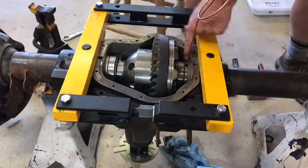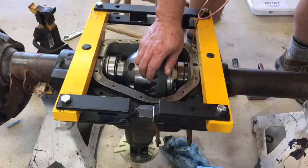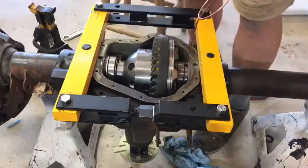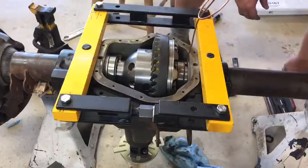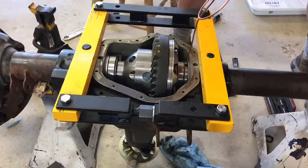I dropped a 5 thousandths shim on this side without taking the whole thing out. Those 5 thousandths shims are so small. I can still feel I have a little bit of play in my backlash. I can tell you it's nice and tight in there now — I would have to pry it out, which means I probably have the preload pretty close to where I want it. Everything still turns nice and good. I'm going to finish this up by putting the bearing caps on and then do a final check on the backlash.